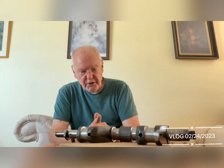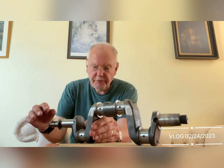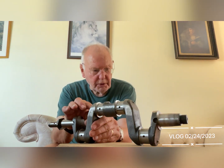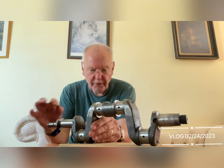What Phoenix have done is they've made a new crankshaft and drilled it so that the drilling goes right the way through, and it's plugged at each end with an Allen bolt. That's how they get the oil from one end of the crank to the other.